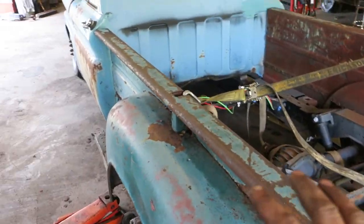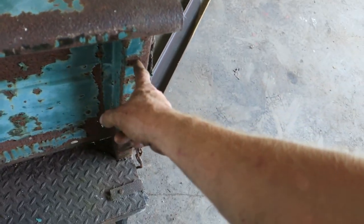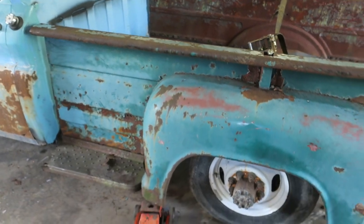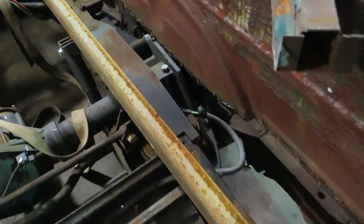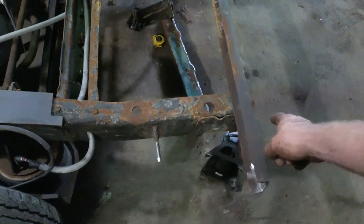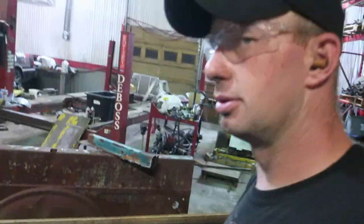That's a good look, I'm happy with that. Dropped the box down just a couple inches. Cut about eight and a half inches off the back. Cut this one off and weld that back on again — just drill some holes through the back, put the front ones back on again. It's starting to look like a pickup truck. I went to VNR and grabbed some C-channel. I welded what I think is the distance across, and if I lay it right across, that's the same height as the C's — perfect. One at the front, one at the back, one right here. We're going to do a wood bed and I'm just going to do a barn board.